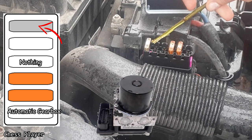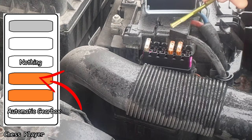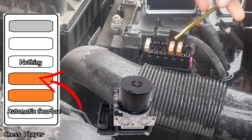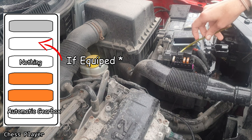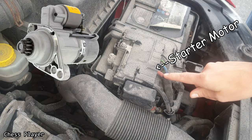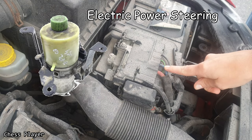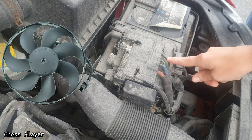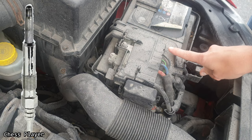This is for the ABS control unit. This one is for the onboard supply control unit, and that one is again for the ABS control unit. If you have a fuse here, it's for the radiator control module and radiator fan thermal switch. This cable is for the alternator — this one has 110 amps. This is for the power steering control module, ABS control module, engine coolant blower motor, and if you have a wire here, it's going to be for glow plugs for a diesel engine.